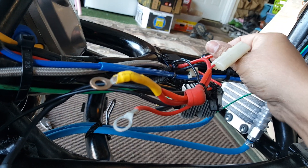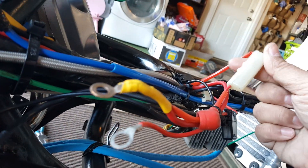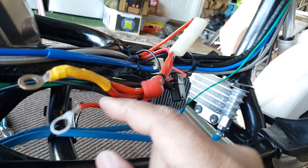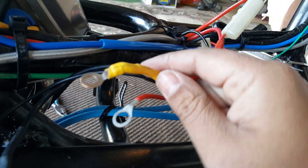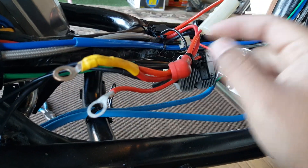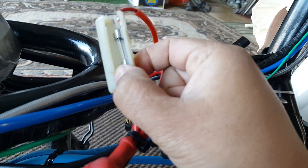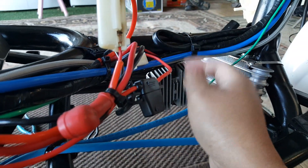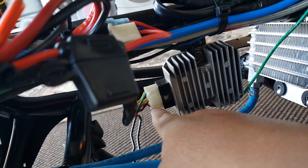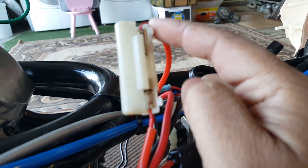This wire right here might be going to the starter motor or possibly to our charging system — perhaps the stator. We can test continuity on that one and see where it goes. But before testing continuity we have to break it off of this main line, or else the continuity will read the same as the bigger wire. We have to break the line here, or just snap it out — or take it from the fuse port, making sure the fuses aren't joined together. That way we can test from this broken continuity line all the way to wherever it's supposed to go — we're thinking probably to the positive wire on the rectifier. So we have to take one of the fuse ends out, keep it open, and find out exactly where this line traces to.